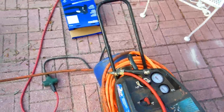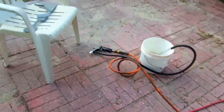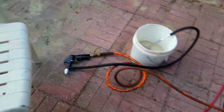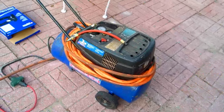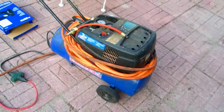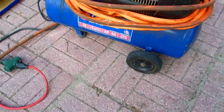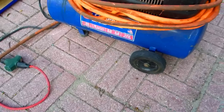I've decided I'm not going to get the 220-volt air compressor because I'm a home user. I'm going to get the 120-volt. Both of those models are cast iron oil type, good quality with a three-year warranty. Considering this little guy is 2.6 CFM, what I'm going to replace it with is a 5.6 CFM.